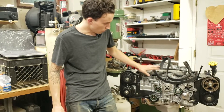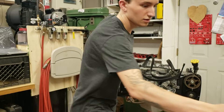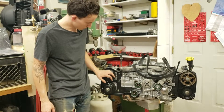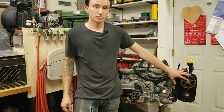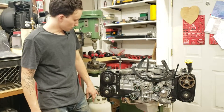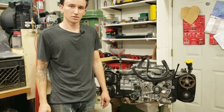Currently I have all the pulleys on except the cog gear. This is the way I do it if you don't have a tool to lock your cams. This side is on base circle, so these are completely unloaded. These cams are loaded on this side, which makes it a little bit difficult to time. You got to be careful because they'll flip easy. We also have all the belt guides off just to make things a little bit easier so they don't get in the way of putting the belt on.